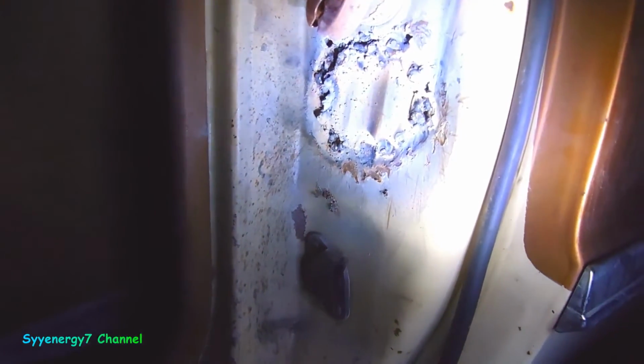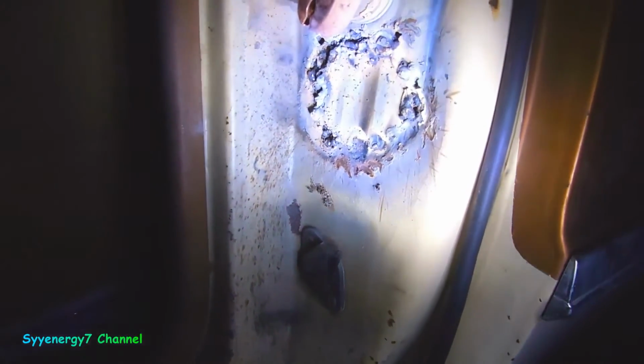Well, that actually came out pretty good. Actually, I got to grind that down. Now, I just used a flux welder, but any little pinholes in there, after I grind it down and tap it in a little more, it's flush though. You can see it's flush. Just going to grind those welds down. It came out okay. I'm getting a little bit better at this already.